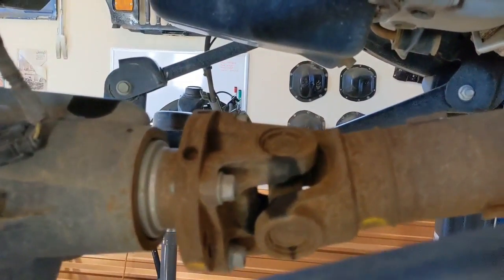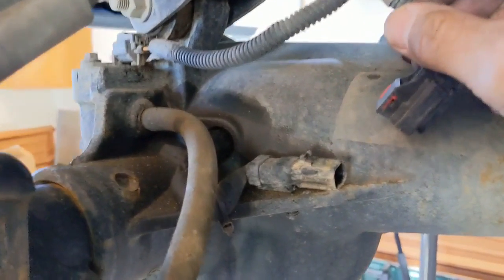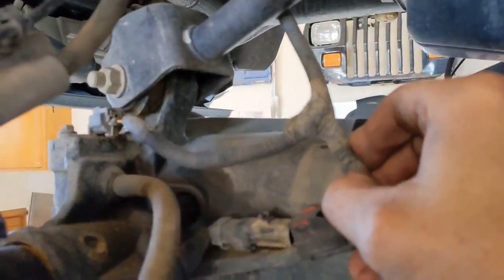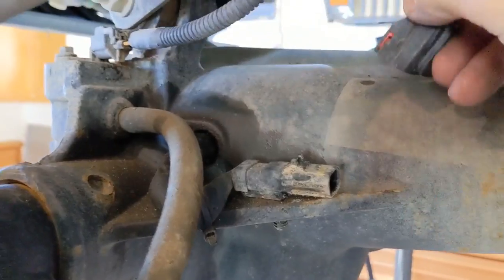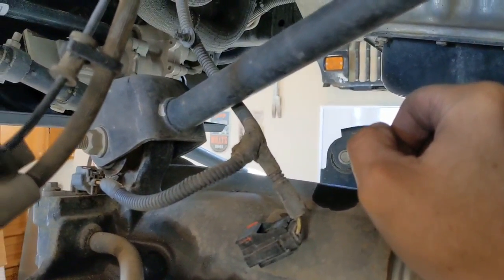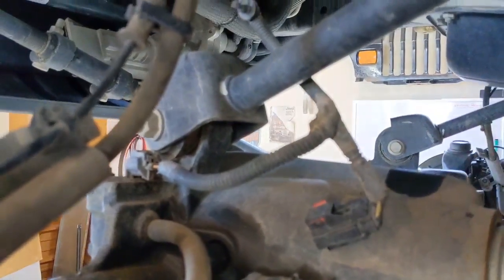Another problem that became predictable is your locker electronics. When it's down here, you can see that if the suspension droops much further, it's going to put stress on this. Not only do you need to disconnect it from the control arm — which has to come off anyway — but go ahead and disconnect from here so you're not adding all that stress. Now you can see how much play we have in the line. Remember the orientation when you go to put your upper control arm back in — the line needs to come underneath the control arm.